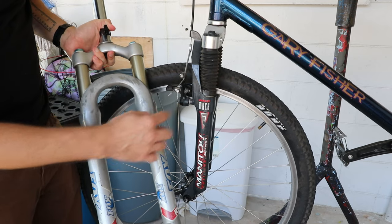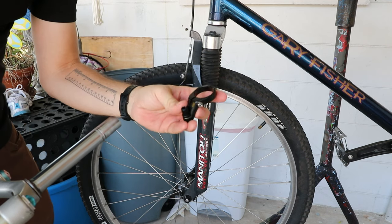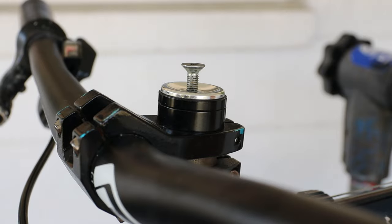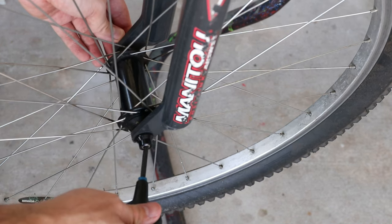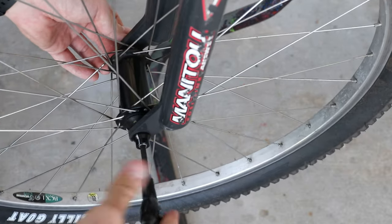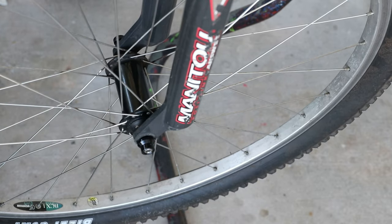I think the brakes are going to work. Since it's a cantilever brake, we'll need to handle the cable somehow, so I bought this adapter for about ten bucks. I'm going to go take this wheel off. One other thing — I don't know if I showed you guys in the previous video, but I did install these non-quick-release axles or skewers. They save around 50 grams total front and back, and I think they look nice too.